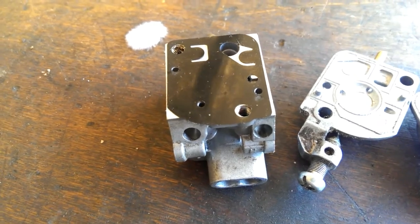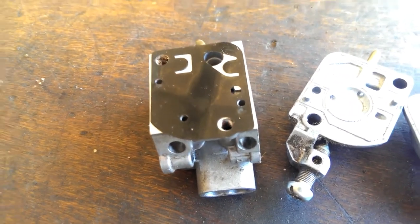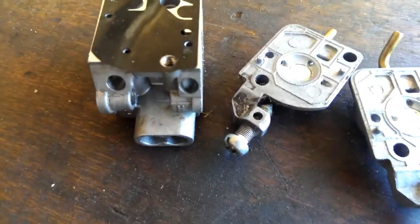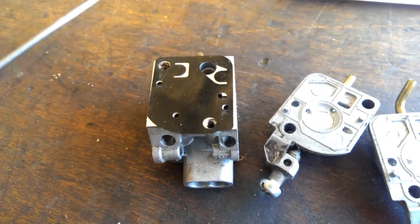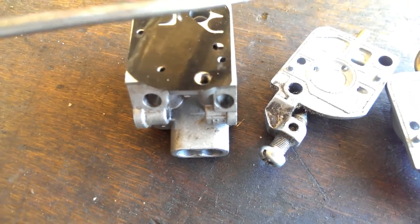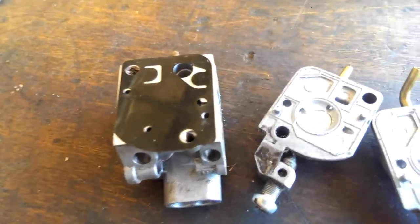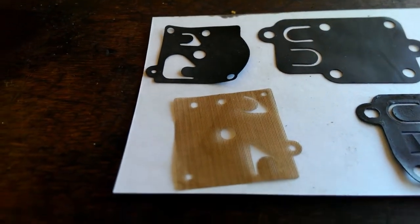To answer the exact question though — what are you looking for? Basically it's going to be stretched-out diaphragms. A gasket is a gasket and those don't really come into play too much, but the diaphragms do. These little pieces right here are one-way check valves — they basically allow fuel to come in one way, then when the pressure changes they close so fuel can't go back on itself. These are like new diaphragms that go into two-stroke carburetors.